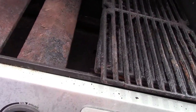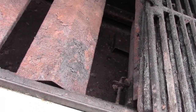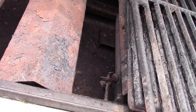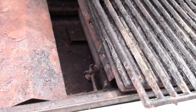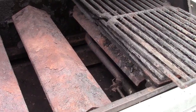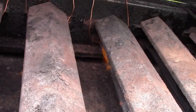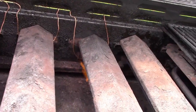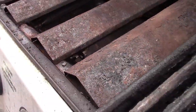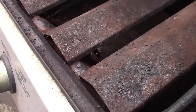This will light itself. Sometimes. Sometimes we have to use the oldie method. It's sparking too. I don't know if you can tell. That's been finicky anyway. There we go. That one's burning now also. So all the burners are lit. And yes, this one is extra hot because, of course, the burner is rusting out. I do have a replacement, along with the new igniter thing, but hopefully you could see in there, maybe, that I put a nut and bolt in there. That worked.